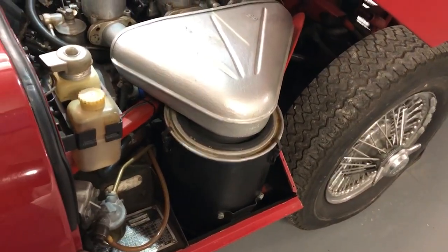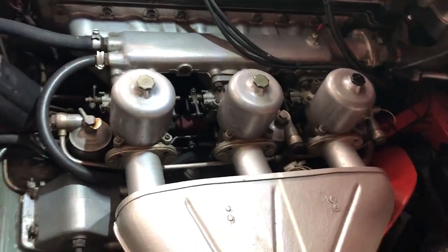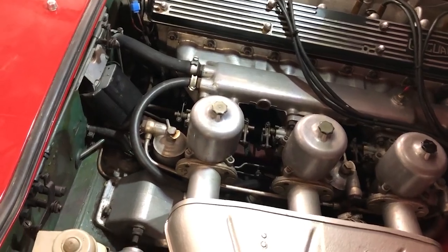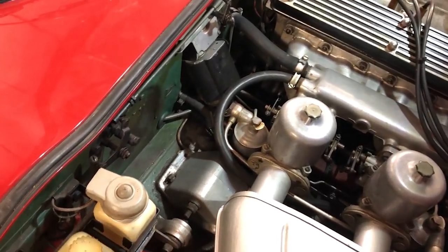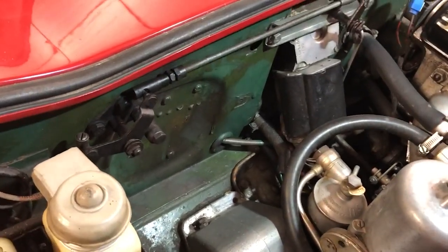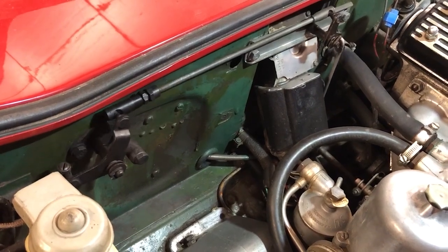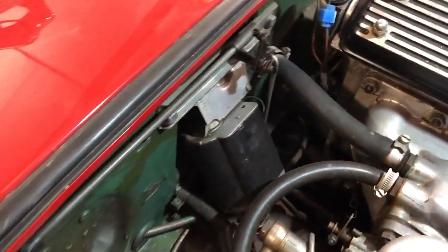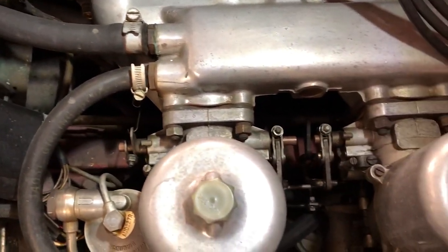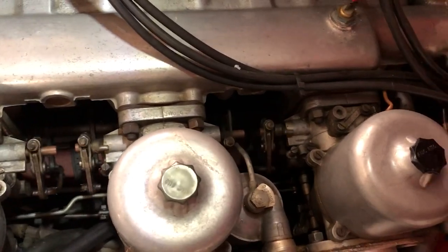The air is drawn in through a filter here and split three ways into the different carburetors. One of the things I like about this is that it's a purely mechanical system. Someone in the engineering office in Coventry back in the day had to work out how to translate the force from the accelerator pedal through a system of levers all the way to the carburetors. You can see here it being operated - through the bulkhead it operates. This lever here and the linkage translates all the way through to all the different mechanisms actuating each carburetor, and of course it's all got to be happening at the same time.